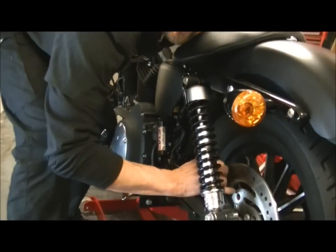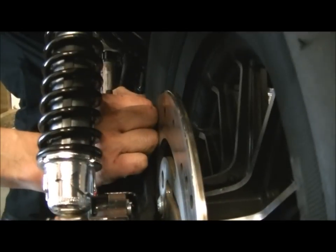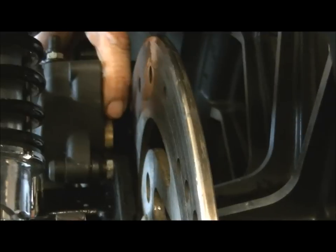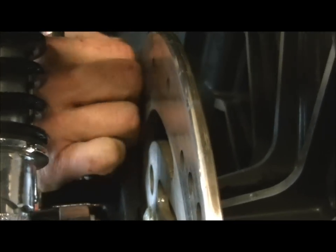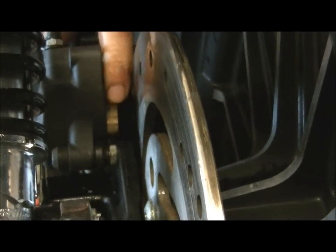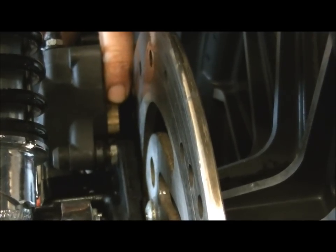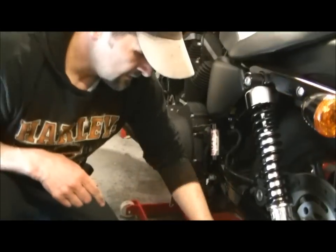Can you get the camera on that pen? I'll show you. Right, pushed it back, right back. There we are. Now you can see it comes out nicely. Also what you're looking for that's very important is if you watch it, as I pump it, it goes in and it goes out again. So a little movement is going back under its own pressure, which is proving that it's not seized. It was a little bit bindy, wasn't it? Yep. Squeezed a little bit.